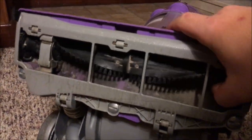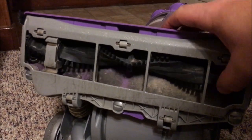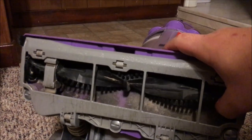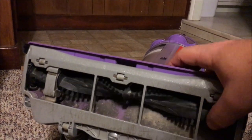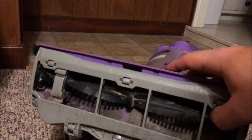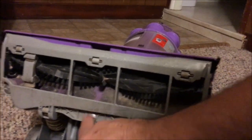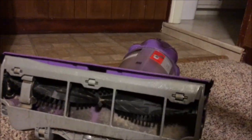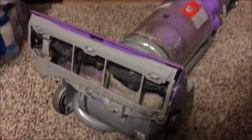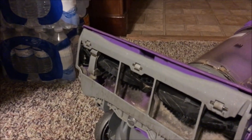Right here is the brush roll on/off — one for bare floors and one for carpet. Let me show you how the brush roll is designed, at least on the clutch models. You can just turn those two screws and the whole bottom plate pops right off, making it easy for brush roll servicing. When I got this, the belts were stretched — it actually uses two belts.